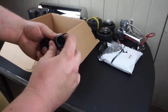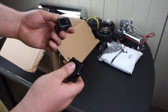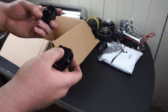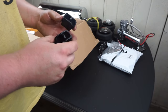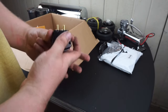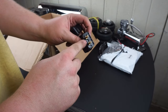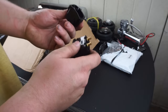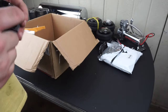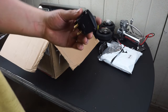Moving to the valves — this is what makes this system actually cheap. These are manual paddle valves. I only got two because I just want the front half and the back half of the car to be independently controllable. You could do all four corners if you bought two more valves, but I'm keeping it simple. It was $30 for both. Very simple plumbing — two fittings on the back, go up to raise, go down to lower. The little hole is an exhaust port. That takes care of the management.